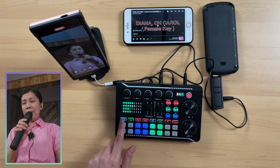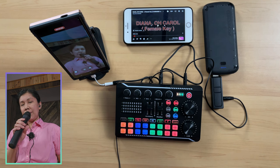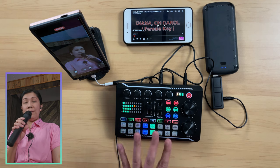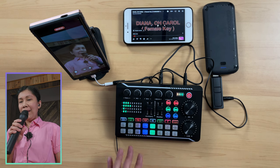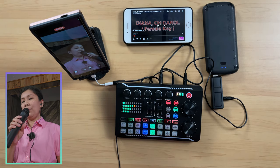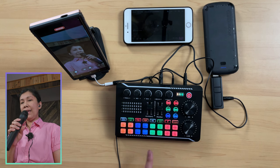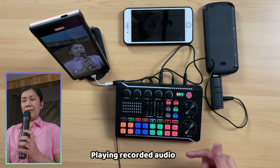For the primal sound — let's say you are using effects and you don't want to use that — just simply tap this primal sound. Sound check — testing one, two, three, four. Pretty much all the features on here you are able to use with this wireless microphone. If you want to know all the features of this F998 sound card, I've made a video on that already and I will be adding a link in the description below. Now, I connected the background music device using Bluetooth, which is why I did not use a cable. Just go to the settings of your device, go to Bluetooth, turn it on, you should see F998, and connect them. Once connected, when you play a karaoke song from YouTube, it should be connected to here wirelessly.